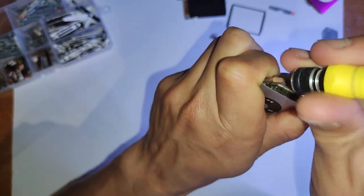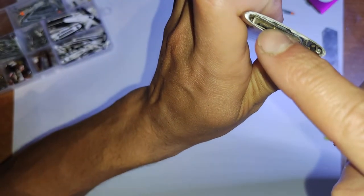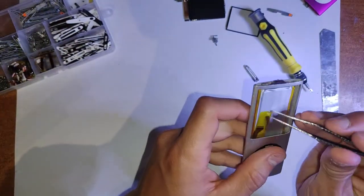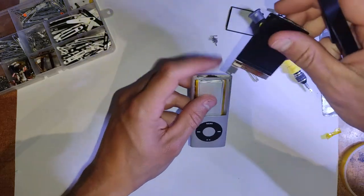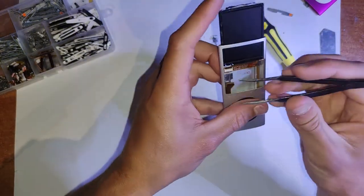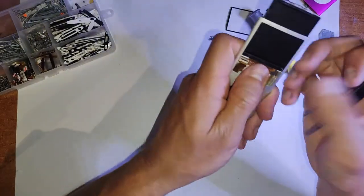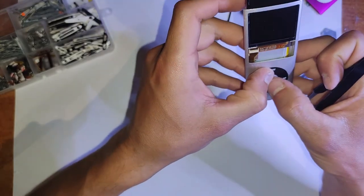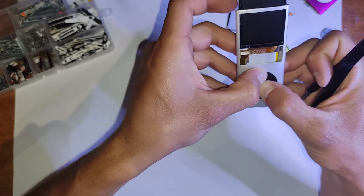At this point I realize I have a bent pin in the 30 pin, so I fix it with tweezers and get it all good eventually. Not every pin in the 30 pin actually does something, so keep that in mind. Sometimes you can have a bent pin that snaps off and it just won't affect anything. Before we put it back together, I like to do another test to double check everything again, because we could have damaged something in that whole process. And at this stage it does look like it's turning on,